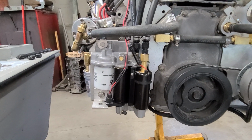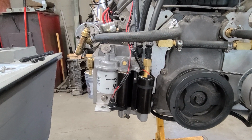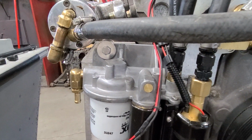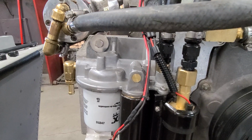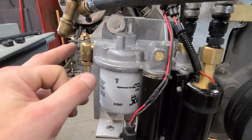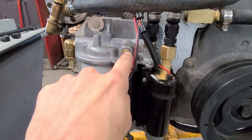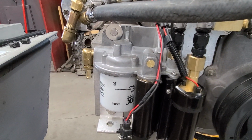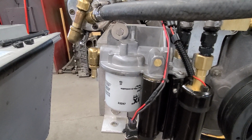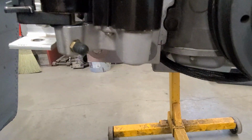So I'm either going to be bringing a lot of stuff to him from now on, or I'm going to see if I can get some of that stuff. But anyway, it worked fantastic. He washes the things. He didn't even charge me because it didn't take hardly any time. So they're completely clean inside and out. That's the nice thing, because they dip these things, that coating gets in all the galleys and everything that you can't get to. You really would not be able to get to that very well sandblasting, whereas you dunk it in a tank of stripper, that stuff went in there and ate everything out. So it's completely clean inside and out, both castings.